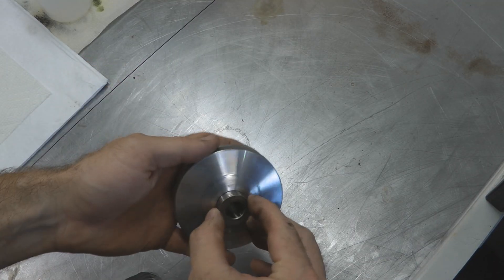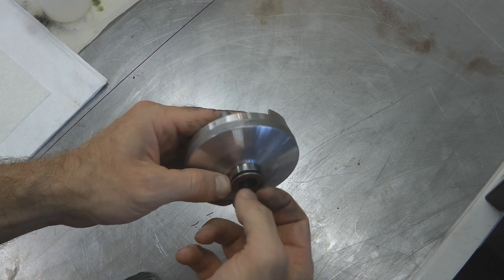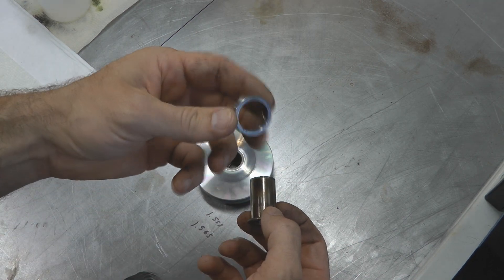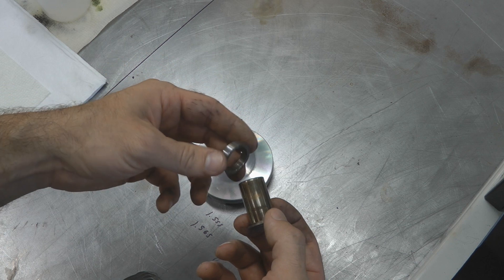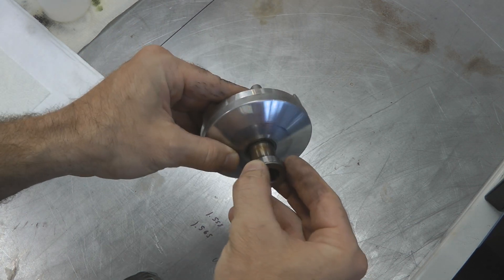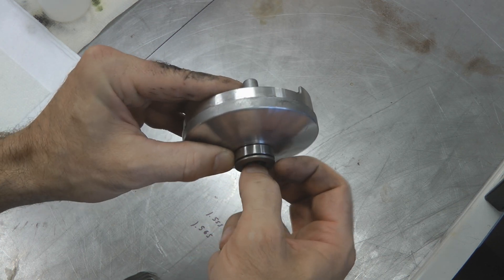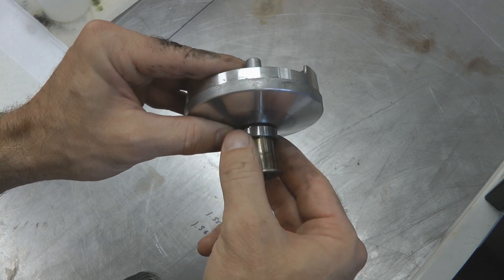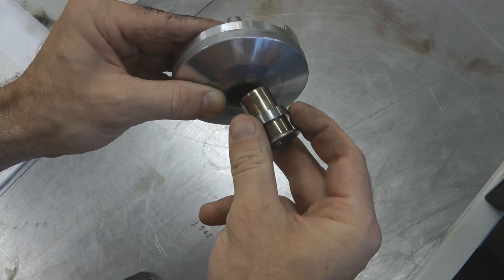Here's what we've got on the bench. There is an internal collar that runs almost the full width of this piece — you can pull it out, and that's the actual speed collar. This is the piece you remove if you want to speed your 50 up from around 8 miles per hour to 15 miles per hour. If you want the speed collar to go back in, it goes on this bushing and then back through the front piece so that the outer edge of this bushing captures the collar. On reassembly we'll revisit the orientation of this long bushing — it's important depending on whether or not you've got the speed collar on or off.